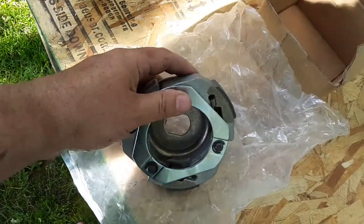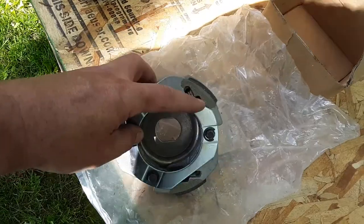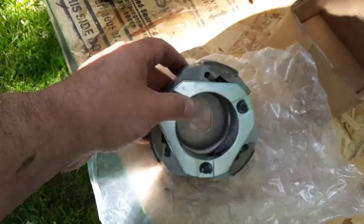This is a 150cc clutch. I want you to tell from those pictures — some of this aluminum here was coming loose. There are like plates under each one of the shoes and there's chunks of aluminum missing on every one of them.